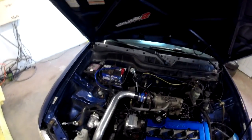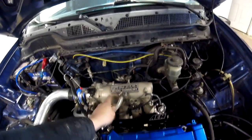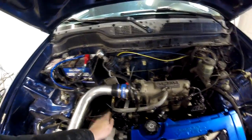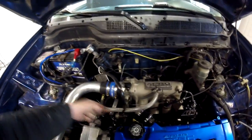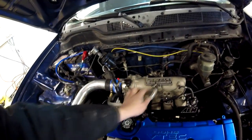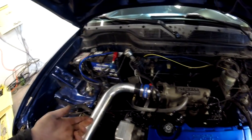They have an oil catch can on the car that's not hooked up properly. Currently they have the line coming off the manifold, which is going to be boost pressure now because the car has a turbocharger. This doesn't work — when you run the catch can into a vacuum source, the boost will actually go into the catch can and then back into the PCV, which would cause more crankcase pressure — the exact opposite of what the catch can is supposed to do. So I'm gonna take this clamp off and run this hose straight to the top of the valve cover where they have the breather port.